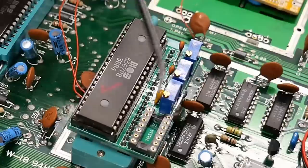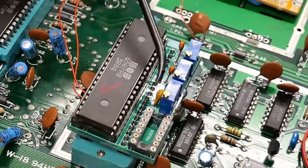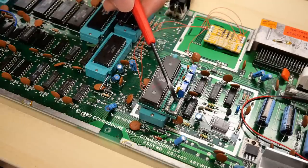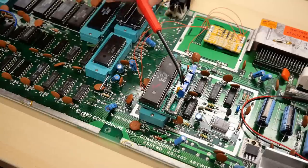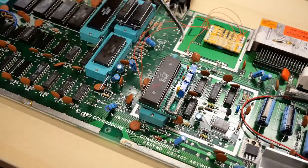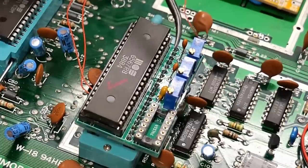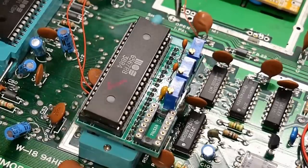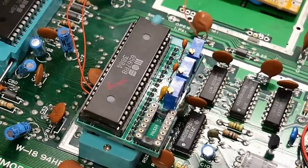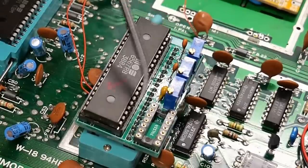Under the VIC-2 chip on this motherboard is a LumaFix board. These boards are designed to help counteract jail bars — the vertical lines on the video signal. They work by using a 74LS logic chip to generate an interference pattern that you tweak with potentiometers to negate the built-in vertical line pattern from the VIC-2. Personally, I could never get it adjusted to look better than the original video output. It might minimize lines on a particular dark gray color but exacerbate them in other areas. This particular board is actually disabled — the chip is missing — so it won't do anything.